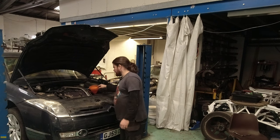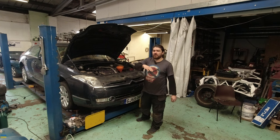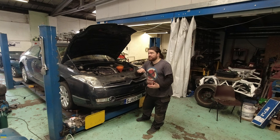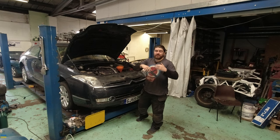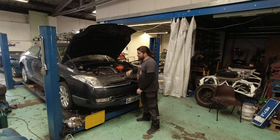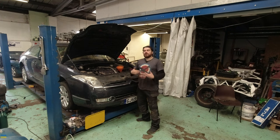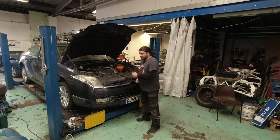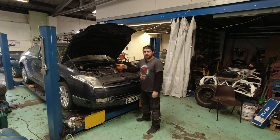I'm going to fill it until it comes out the bottom while the engine's off — that won't be the right level but it will give me something. As soon as you start the engine, the pump runs in the gearbox and the oil level drops, so it's more likely to leak when you haven't got the engine running. I'll put enough in that it spills without the engine running, then I'll start the engine and top it up further until it leaks back out, then cycle the gears.